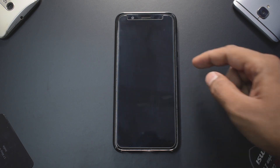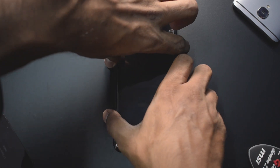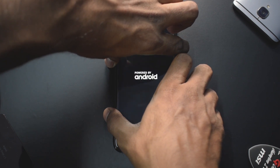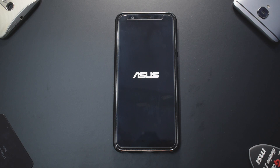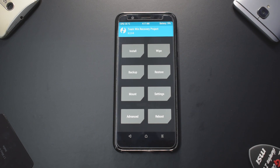Once the phone is powered off, press and hold Volume Down and Power to go into TWRP. The moment you see the 'Powered by Android' logo you can release those buttons and it should boot into TWRP just fine. You'll need Google Apps and the ROM files, and it is recommended that you be on the latest stock ROM before attempting this to avoid errors. Just to note: this ROM is based on Android 9.0 Pie.